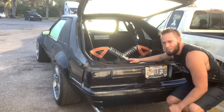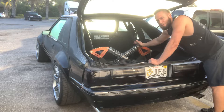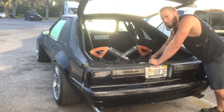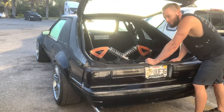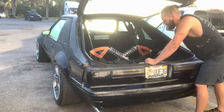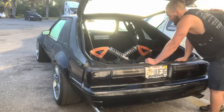It really doesn't do much more except move the springs up into the top rather than down below. A lot of times race cars use this because they don't have room for the coilovers down below — for tire space or suspension movement. I did it because it looks awesome. It also reduces unsprung weight, so rather than moving a whole coilover you're only moving this little rod that goes down to the lower control arm.